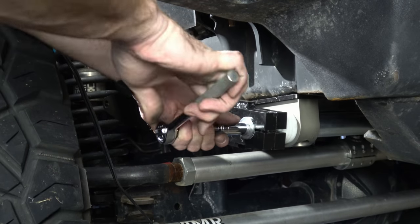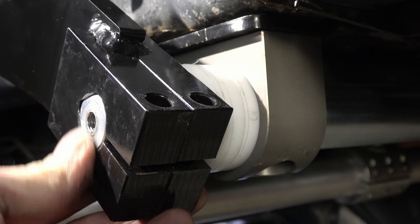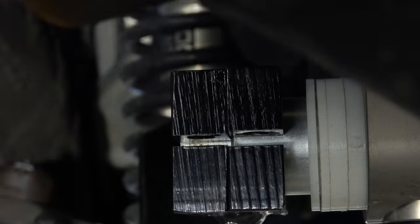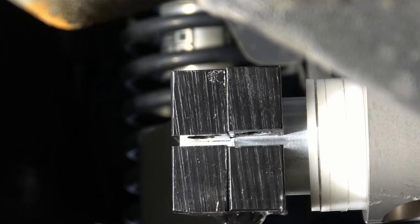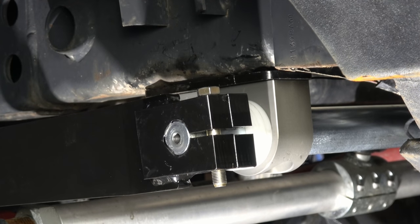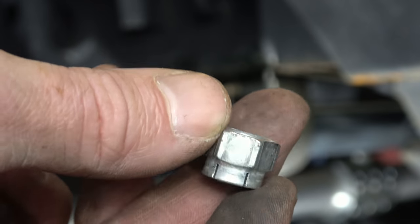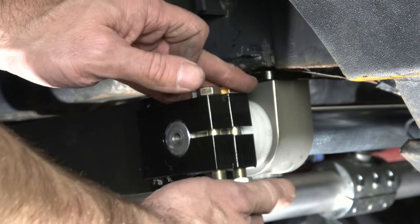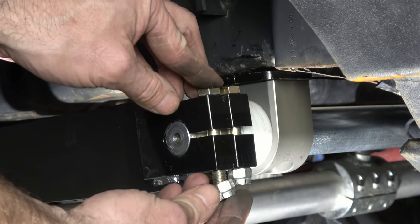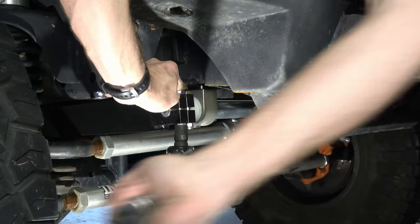It doesn't take a lot of pressure to suck the arm onto the end of the torsion bar. If it takes a lot of pressure, if you feel like you have to crank on it, you probably have your torsion bar misaligned with your arm. It started out really light, so I know that everything was aligned properly, but now it's getting pretty hard to tighten down — that's telling me it's cinching up tight. You can visually look or use a zip tie end to make sure that torsion bar goes all the way to that center seam in the arm. Now I'm putting these bolts through from the top and adding in these aircraft locking nuts — those go with the flat of the nut facing up against the arm. These locking nuts are going to get torqued to 45 foot pounds.